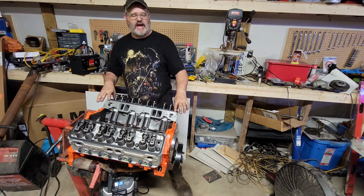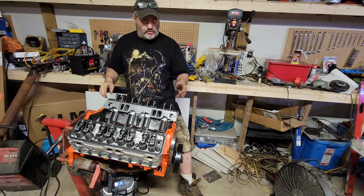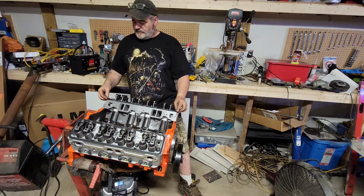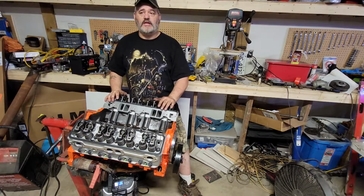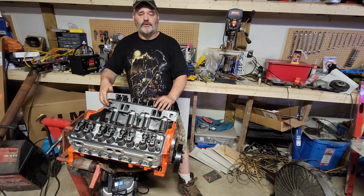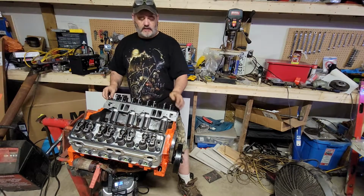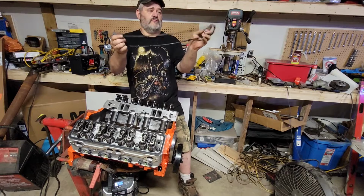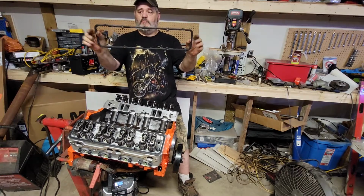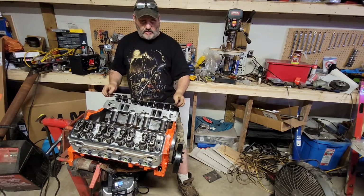The cork ones were bad, and that's where the reputation came from, those old cork gaskets that everybody used to use. And they would do them with the engine in, change the valve covers, and they would do things like put a wire under the darn thing, or the cork wouldn't be lined up right. Okay, these new ones, they're steel inside. They don't bend, they don't twist, they don't warp, nothing. These don't leak. You don't need silicone.